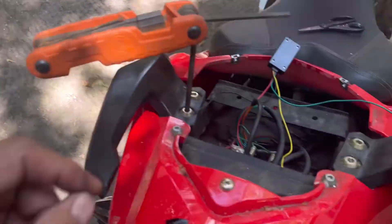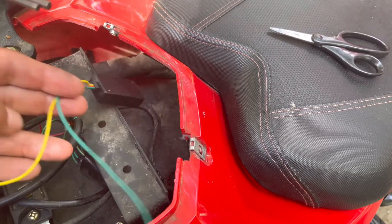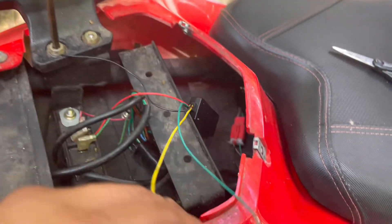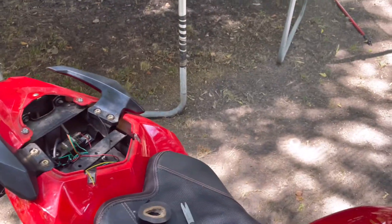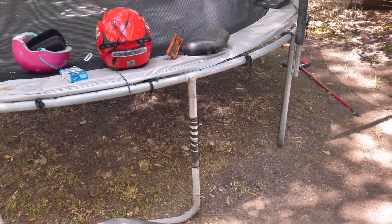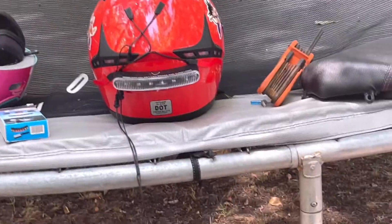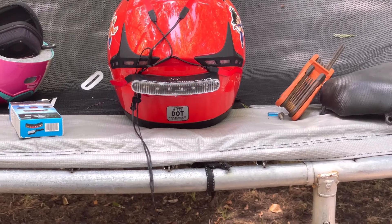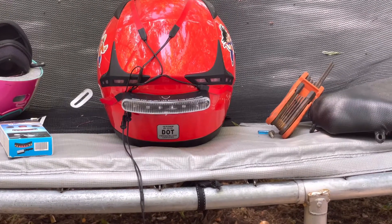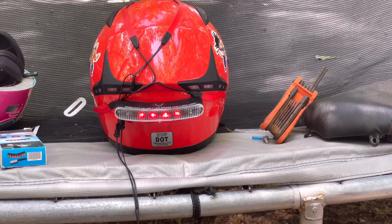Now I gotta connect the signal lights and the brake light to work properly. Little update — I was wiring it wrong. I had the daytime wire connected, but I guess this one doesn't have a daytime light; it just has a brake and signals. I got the brake to work though — it's working right here. There's no wire for daytime running light, and when I tried putting the running light wire on the same wire as the brake it just shorts out. I wish it had a daytime light — that would be cool — but let's get the signal light working and we're almost done.